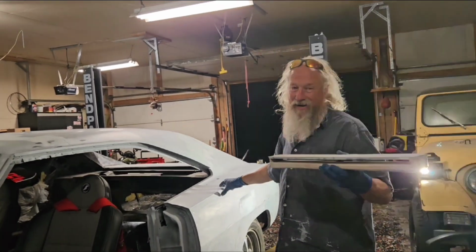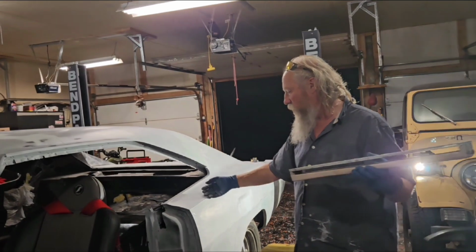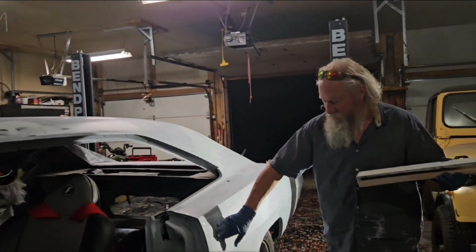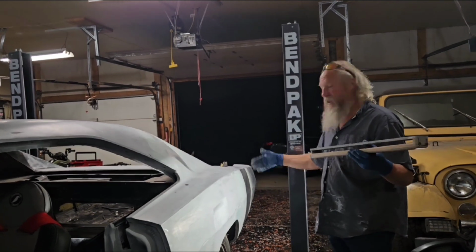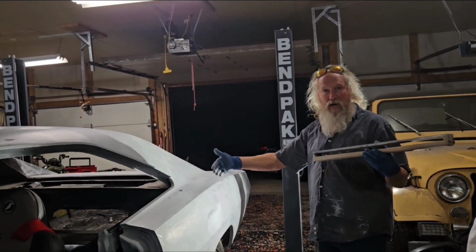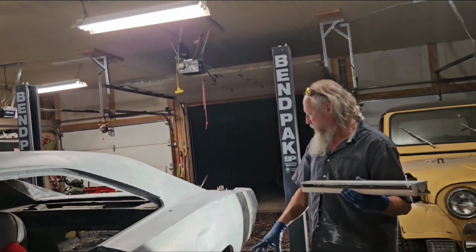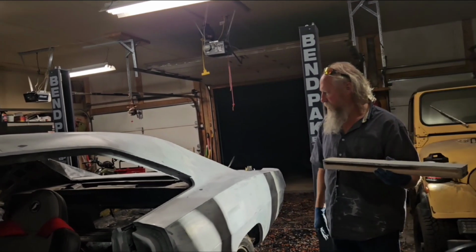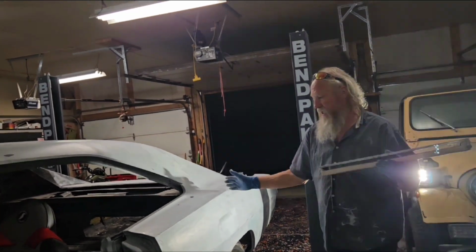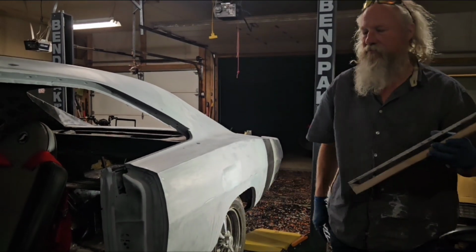And then we're sanding the primer, not a quarter inch, but you need a good amount on there. Okay, and we'll guide coat it, and it'll fill some of these imperfections too, the air bubbles, stuff like that, and then we'll come back. And I'll show you how to sand the whole thing with that. It'll show every little imperfection. It'll show these more because we'll put the guide coat on there a little more. Okay. And I like it to where that guide coat is almost, right here is not bad, but I would still say a little heavier.